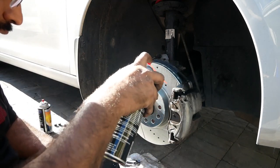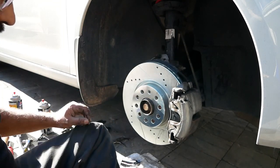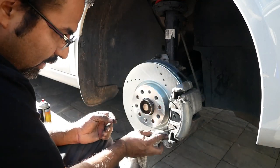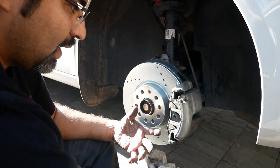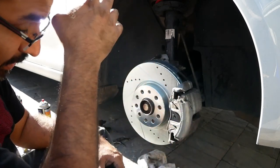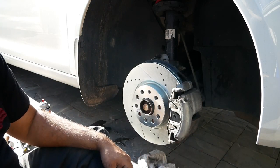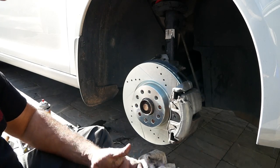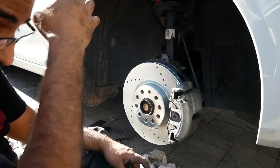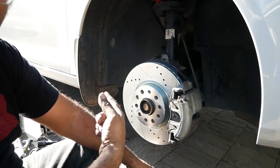If you wanted to clean it up, go ahead — brake cleaner will not hurt the pads. What will hurt is any type of grease, which will definitely damage your pads. If you had brake pads with shims, you would grease up the shims only, but this setup does not require it. On the driver's side, remember that one wire has to be fed through the back of the caliper — that's called the wear sensor. Then put your wheels on and we'll work on the rear brakes.